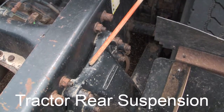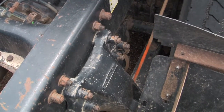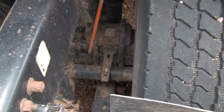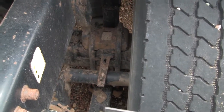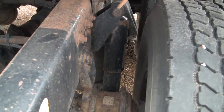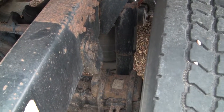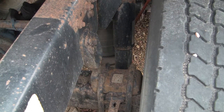Now I'll start with the suspension. Here's your front hanger — make sure it's mounted securely to the frame. I check the leaf springs — make sure they're not cracked, broken, or missing. I check the U-bolts — they're a little bit longer here — make sure they're not cracked, broken, or missing. I check the shock — make sure it's not bent or twisted and secure on the top and bottom. The air bag is what secures the back of the leaf springs — it has to be secure on the top and the bottom, not leaking or dry rotted.